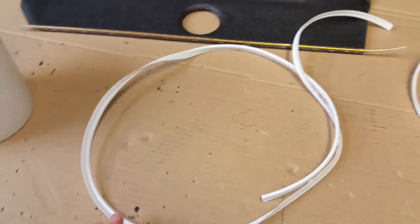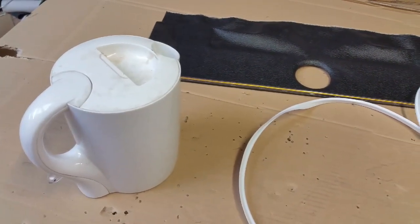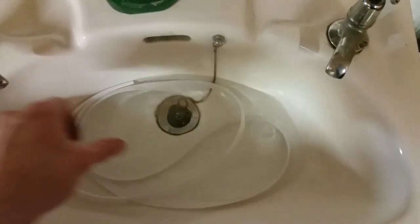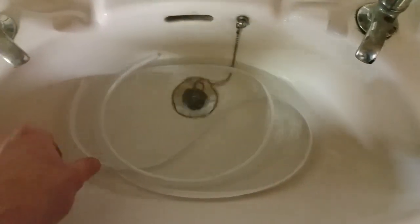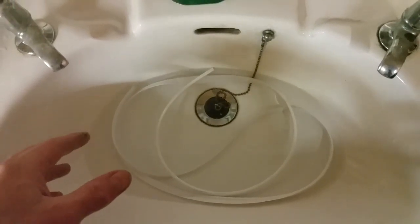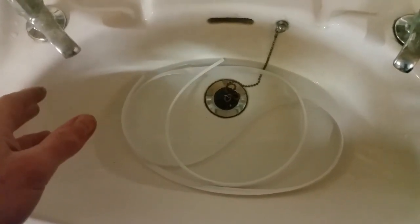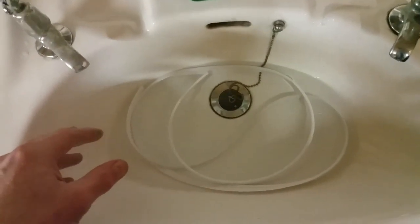The trick to get it running true before you even start fitting it — and I don't mean a cup of tea — so that's boiling water in the sink with just a piece of piping. What we'll do is just give it a minute or two in there. It softens up and becomes really pliable, and once it's been in there for a little bit, we'll just pull it out, keep it taut — usually put a clamp on the end and just hang it — and it'll basically reset so it's straighter, so that when we actually fit it to the cab it'll fit much more easily and straight.